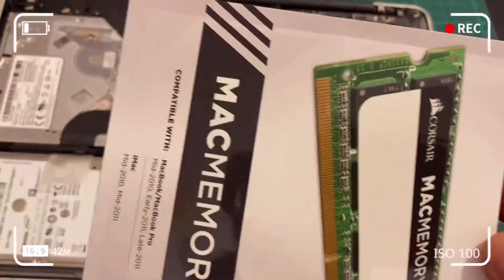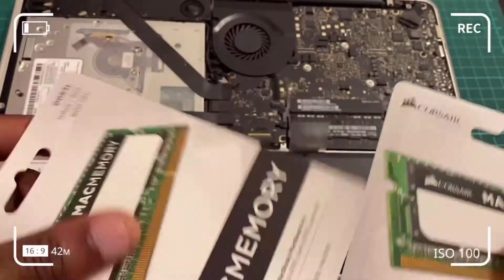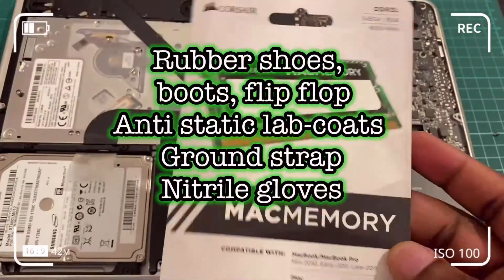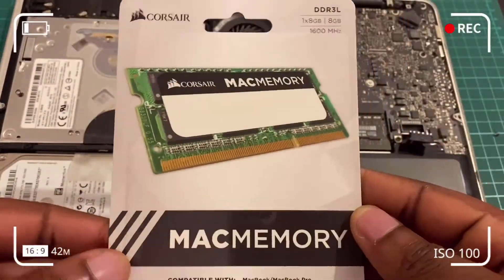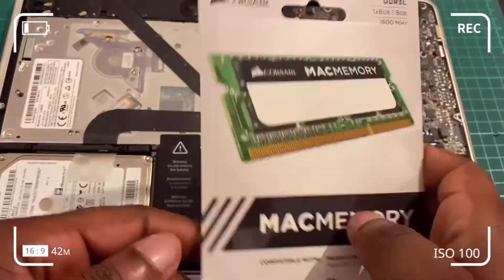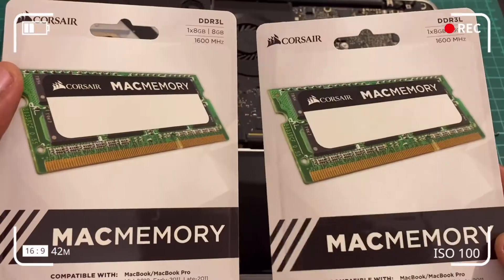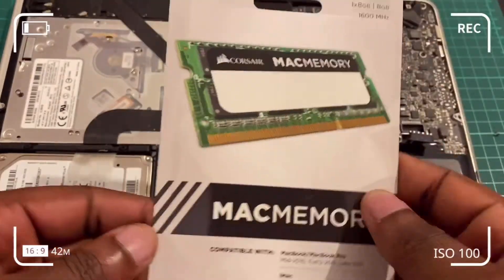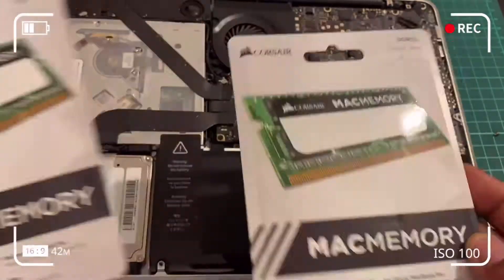You're dealing with a lithium-ion battery here, so prior to removing the RAM, watch out for static and make sure you're grounded. Wear a ground strap around your wrist. Nitrile gloves, rubber-soled footwear, and an anti-static lab coat are preventative but optional. I'd advise draining your battery a little before carrying out this activity. I've grounded one finger to the right-hand side of the chassis while removing the RAM — not compulsory, but a good preventative measure.